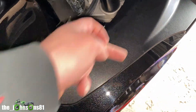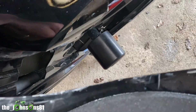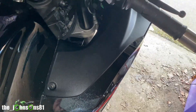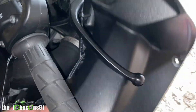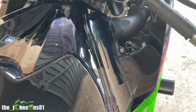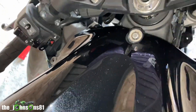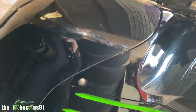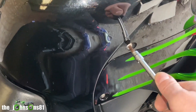When you remove this top air intake fairing, bear in mind that right under here are a couple of clips that go underneath — they fit underneath that bit of fairing on the side, so you have to push it forward. Once that's off, take this top cover off the front of your tank. That's three bolts: one at the top and one on each side on the fairing — same the other side. Again, don't lose your plastic washers.